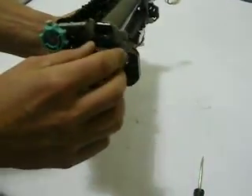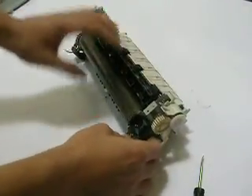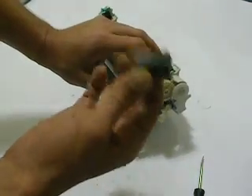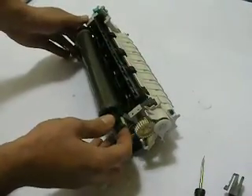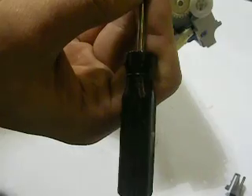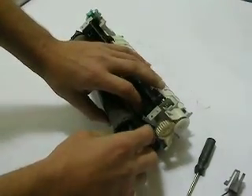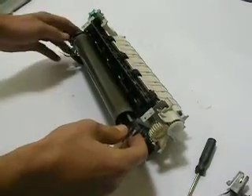So I'm going to keep this side on. But we are going to want to pick this up just a little bit. As we pull off this side — now the side with the exposed wiring harness — we're going to just lift it up by lifting up the other side a little bit. We can unplug this wiring harness — simply just squeeze it and pull it out. Now, there's also a little white clip that keeps the collar on the sleeve, and it's right here. We want to be really careful right now at this point to not hurt the sleeve or the element that actually heats up. There's the white clip — I just simply pressed it back and it'll fall right off.